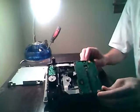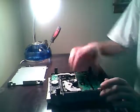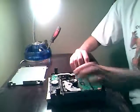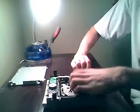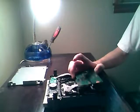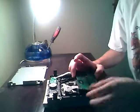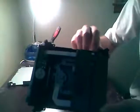Now you can see the board hanging out on the inside of your case. The only thing we have to do is remove this little black clip here. Just pull it back and lift up on the little motherboard, then pull back and it should just pop right up. Be careful how high you pull it because you don't want to rip out any of these fragile cords. All you have to do is pull out this connector, pull this one out, and pull this little white one here — I'll show you all three. Pull out the small white one, the bigger white one, and the even bigger one, then discard that board.